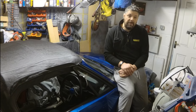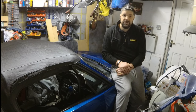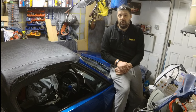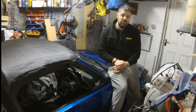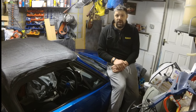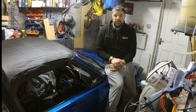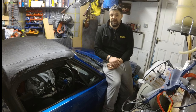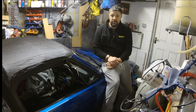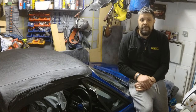For a long time, people have been using four piston calipers on the front of Triumph TR7s, and to overcome the longer pedal travel there, they used the master cylinder from a Sherpa van. Now, these are becoming rare and hard to get hold of, and people want a lot of money for them. Fortunately, I've managed to get hold of one at still at sensible price. I've rebuilt it, and that'll be the next video. But in the meantime, the brakes do work really well.